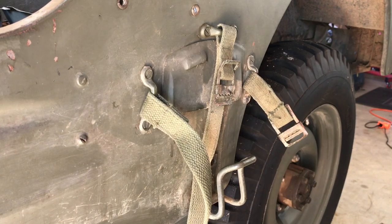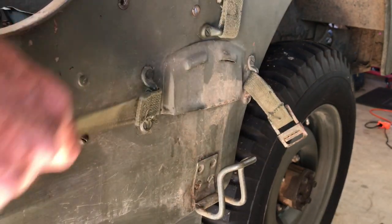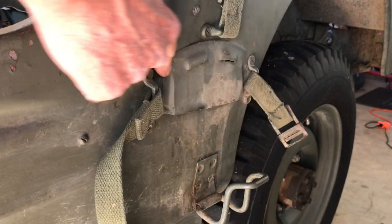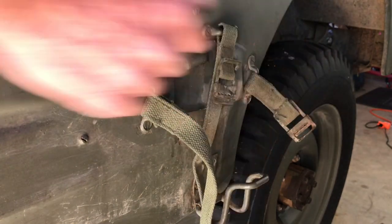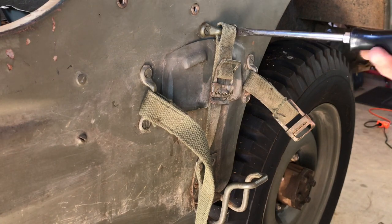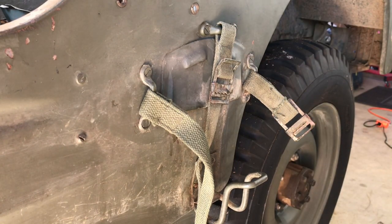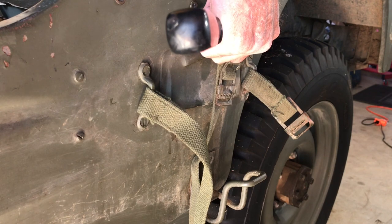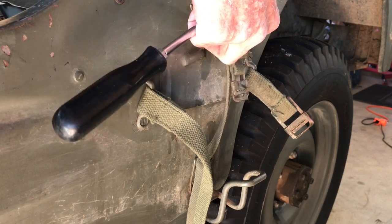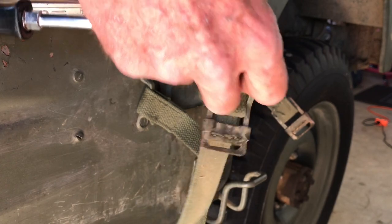Now that I've got the gas tank removed from inside the tub, I can access some of the fasteners from the back side of the tub for the axe and shovel straps. You've got your rear axe bracket, your sheath — that's welded to the tub — and these straps that are held on the side by footman loops. Start by taking the one on the top off first. There are actual nuts on the back side of these screws. I like to keep all the original hardware. You can see that these straps just slip through the footman loops, and then they're screwed onto the side of your tub.